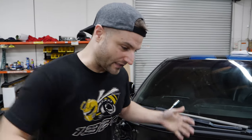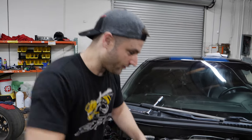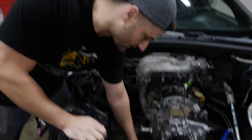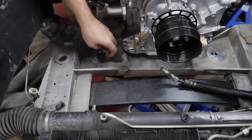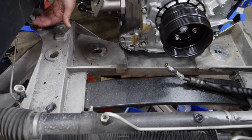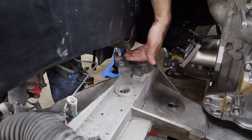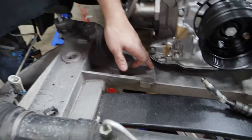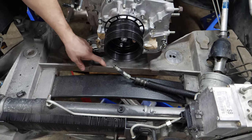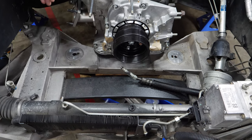This is full force, full feed, full function — all full speed ahead. The nice part is it's all my fault if it doesn't get going from here on out. We have 40 days until LS Fest and we are a little bit behind because of waiting on the subframe, but you saw how good that work was. Here's our current status: we have this subframe that needs to get cut. We've stared at this for hours and the engine and the subframe do not like each other. This subframe is two inches below its correct operating height. We're going to cut here and here, the same on the other side, and reinforce what is actually empty inside. That solves one of the two problems.